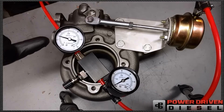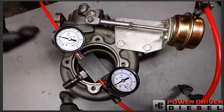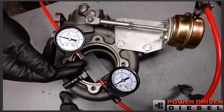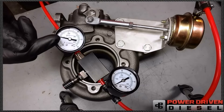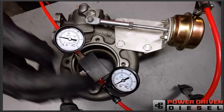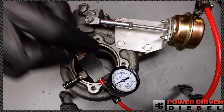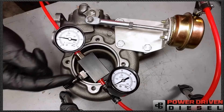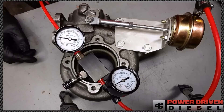You'll notice this side is about 15 pounds of boost and this side is about 1 pound of boost. So whatever pressure you have on the boost side, this wastegate side is going to be 1-for-1. So if this cracks at 15 and you're now at 20 psi on the boost side, the wastegate side is going to be 5 psi — it's a 1-to-1 ratio. Any amount of boost over cracking pressure, you'll just have that amount on the wastegate side. If you've got 25 here, you'll have 5 there. 30 over here — if 20 is your cracking pressure.